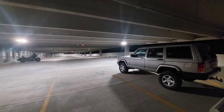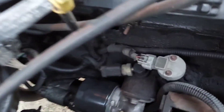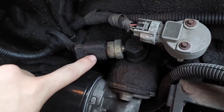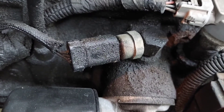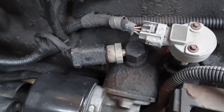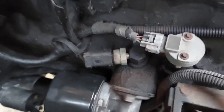My XJ never fell below 20 PSI until my rear main seal started leaking — I have a video on how to replace that if you're interested. If the oil gauge is reading really high or gives wonky random measurements, I can bet money the problem is with the oil pressure sending unit. It was one of the first things I ever replaced on my Jeep. It's a simple and easy thing to do, it's a really common problem, so before you tear apart your engine trying to find something wrong, try replacing this thing.